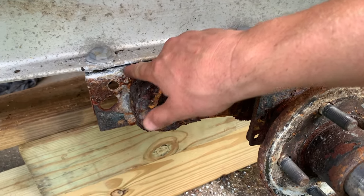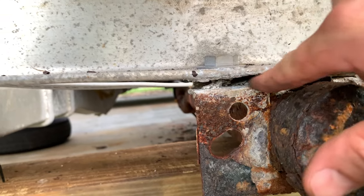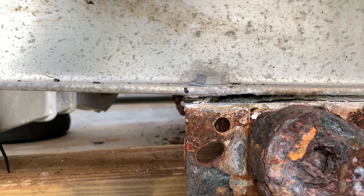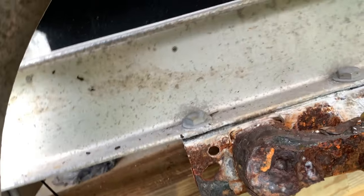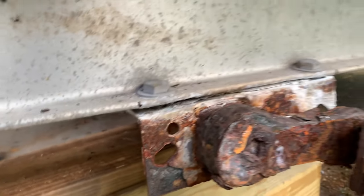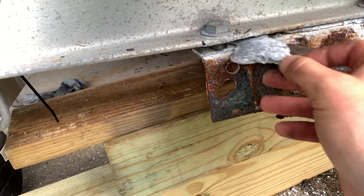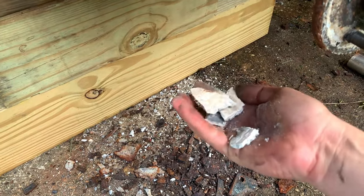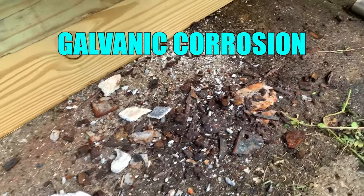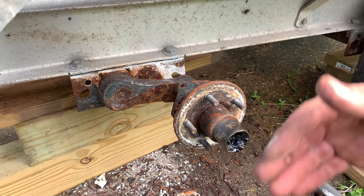Right here it's oxidized because the steel and the aluminum react to each other. There's a plate in here — normally they've been making them out of aluminum so that the plate goes before the trailer goes. Look at all this — it used to be aluminum. Now it's just oxidized — whatever aluminum turns into when it oxidizes. This is kind of giving me a pain, so I'm going to jump back to the other side and pull the bolts from that to see if I can drop this a little easier with all the bolts off of it.